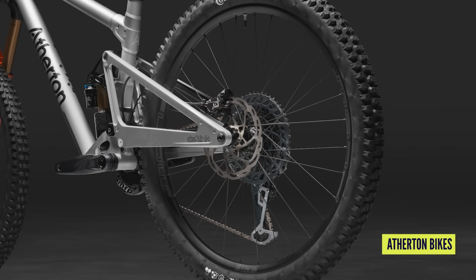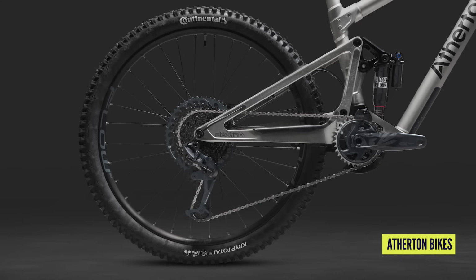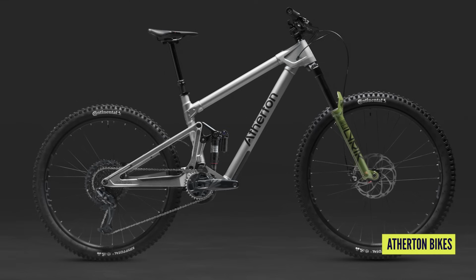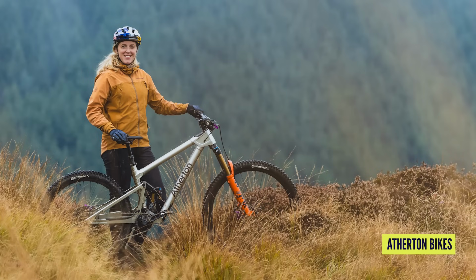There are some other changes from the additive made bike, the World Champ DH winning bike. As opposed to using the DW6, it uses DW4 linkage, so slightly different. This one is 150mm, as the name would suggest. It's MX wheel size only. 64.5 degree head angle, 77.5 to 79.5 seat angle. The reach runs from 415 to 525.